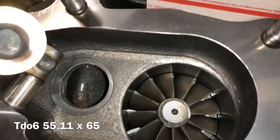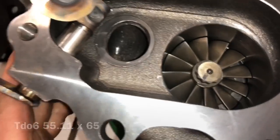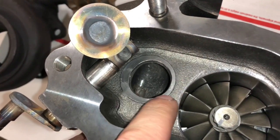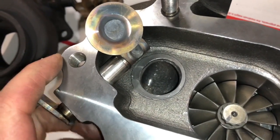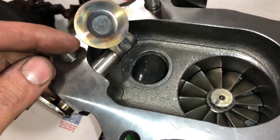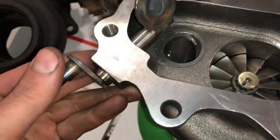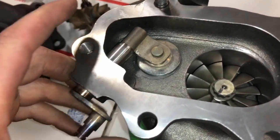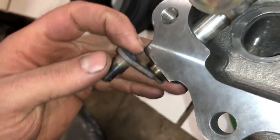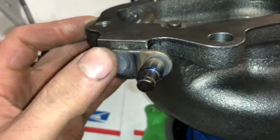I have this fitted on loosely so you can see my machine work. I machined the turbine housing from TD05H to a TD06H turbine wheel. I also ported this out a little bit bigger to prevent boost creep problems and to pick up a little more power. I also tack welded inside the flap to make it more sturdy, and tack welded the back of the connecting arm as well.